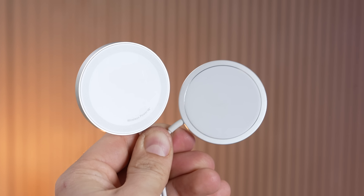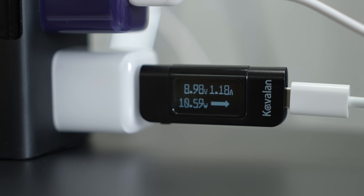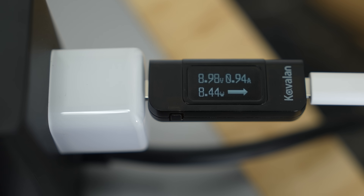If you think the original Qi was broken like I did, just wait. Both MagSafe and Anker's Mag Go Qi2, which output 15 watts, will pull just over 18 watts to make this happen. But at roughly the 20-minute mark, they were both throttled already — MagSafe pulling around 11 watts while Qi2 was pulling 12 watts, which is why it charges faster. The original Qi1 was pulling over 8 watts, still maintaining its full 7.5-watt output instead of throttling.